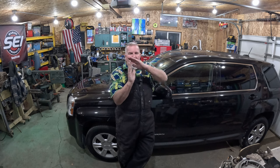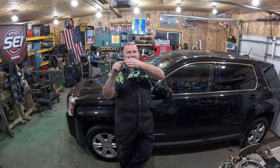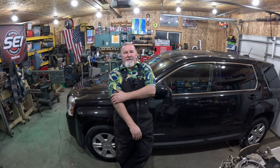Anyway, I think there's a situation where, if you change the oil on a regular basis, you keep those tensioners in good shape. There's a big old arm in there that has some kind of plastic on it, slippery and high wear resistant plastic, that keeps the tension on the timing chain. Now, the interesting part is the fellow I watched said you could hear this little ting, ting, ting, ting sound, this metal contacting sound, in the first 10 to 20 seconds, maybe 30 seconds of running at startup, and then it went away. Well, I thought that was kind of interesting.